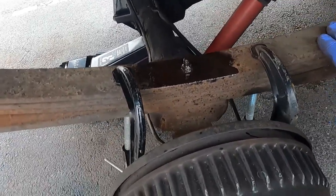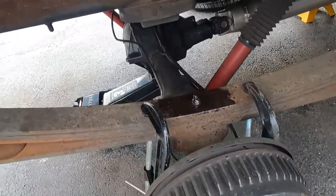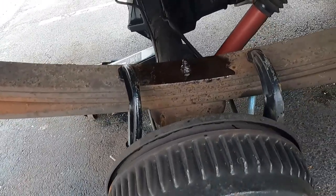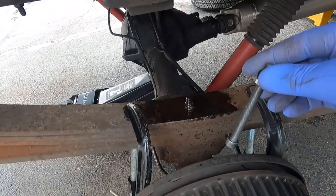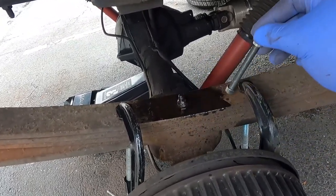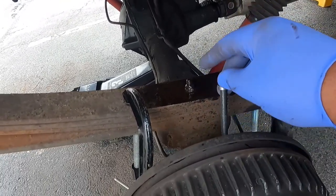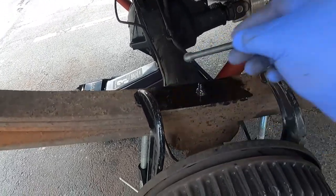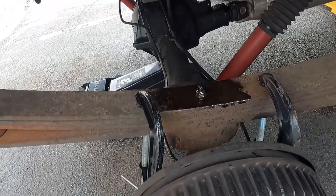these leaf spring center bolts, matter of fact, I have one here. The leaf spring center bolts don't have a hex head or anything like that. They're just a smooth dowel at the end, and that goes into the seat where the leaf spring sits on the axle to center it. So hopefully I can get some grips on the one that's in here and be able to zip this off. And I got the clamps here, very important. These clamps help the leaf not just whop and separate super hard, super fast.